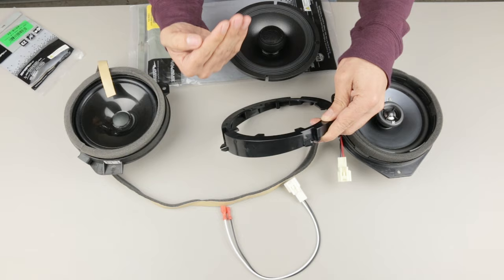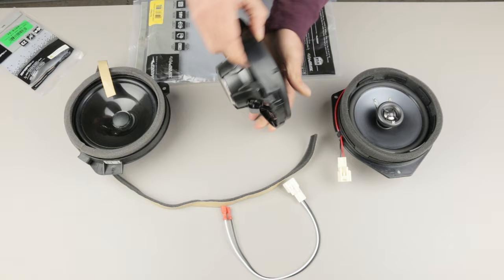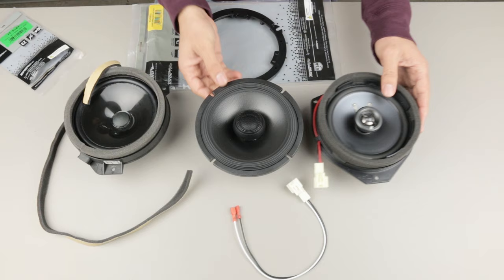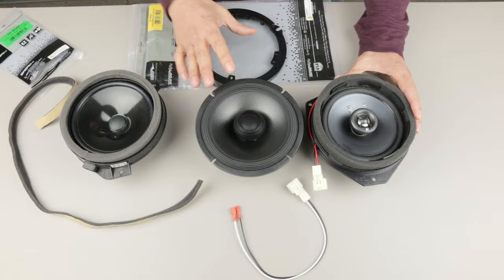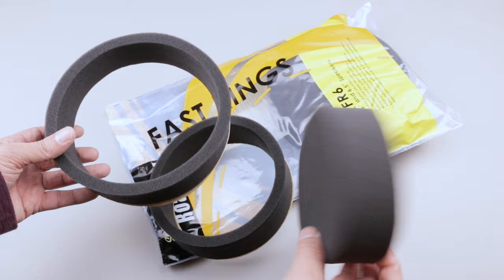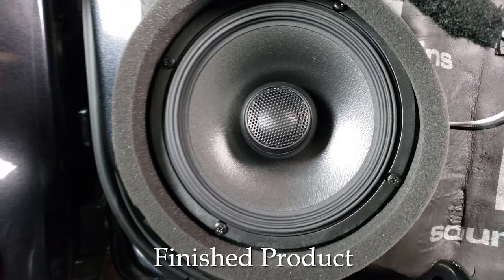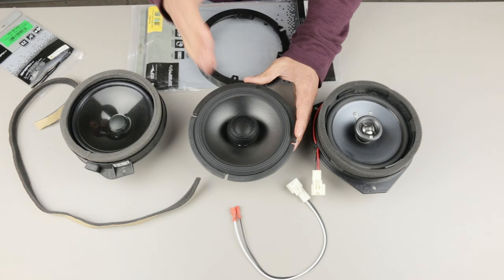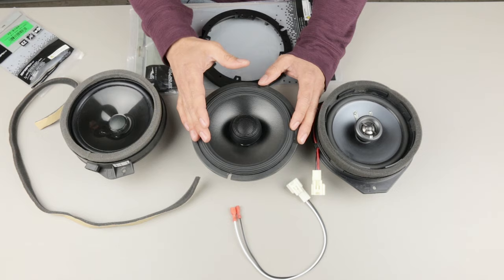Before you install the speaker, take the foam tape and put it all the way around the speaker to prevent plastic on plastic. You may also notice the foam on the outside of the speaker — that's a speaker ring kit, and that's another expense I recommend. There are several varieties but they all work basically the same. You'll have one ring that goes around the speaker, another ring that goes behind the speaker so you can mount it against the door panel, and another piece that goes against the metal behind the magnet. That's going to ensure your acoustic energy is leaving where it's supposed to, prevent wave cancellation, and ensure you get the most out of the SoundSkins installation.